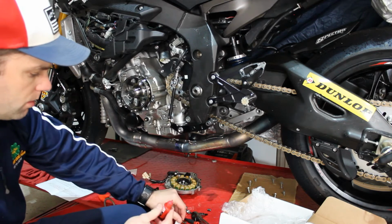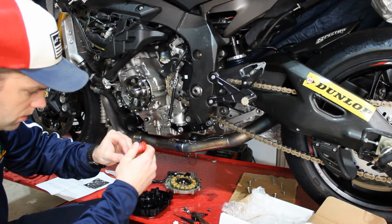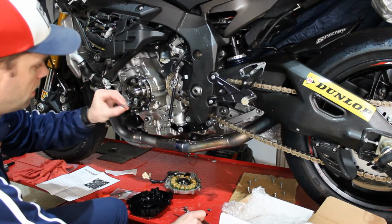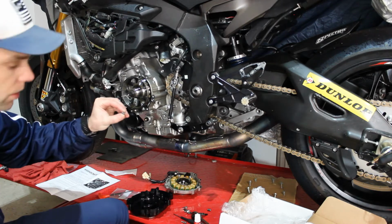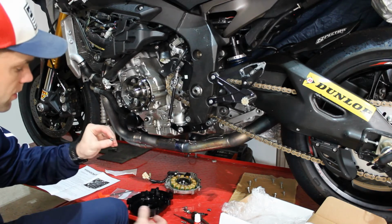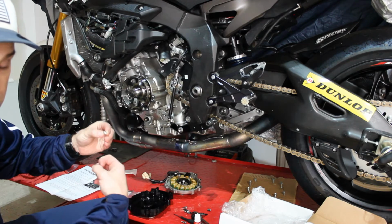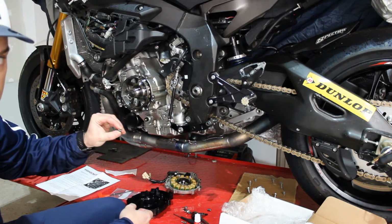So we take our red permanent Loctite, put a little bit here on the threads. One of the interesting things about Loctite that I didn't realize, watched a cool video the other day, I'll try and find a link in the description, is that Loctite works when all the air has been removed. So right now, sometimes you'll buy a part and it'll have Loctite on there and you think, oh, well, this stuff's already cured. The Loctite only cures when the oxygen's pushed away, and the oxygen gets pushed away when you take this, insert it in the cover and screw it down. Then you picture those threads, they tie together, pushes all the air out, and then it cures. So that's why you can get manufacturers that ship stuff with Loctite pre-installed.